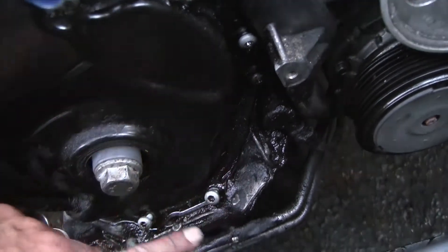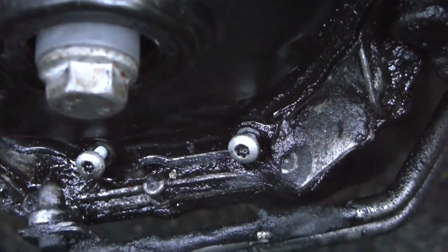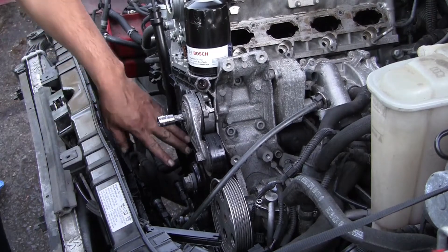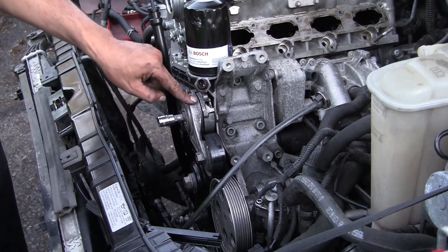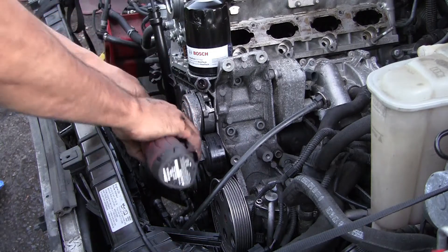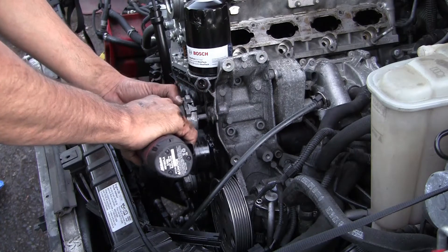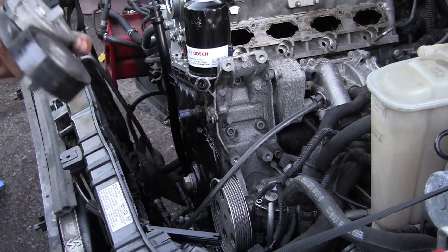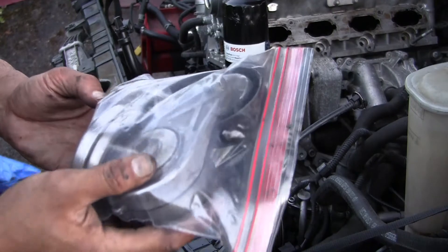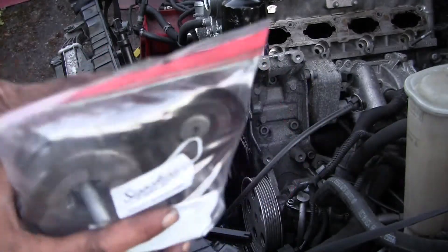There's a lot of junk, dust, and dirt that has piled up here, so I'm going to have to clean it first before I remove this cover. I'm going to remove the tensioner — it takes an M12. Once you remove the tensioner you have a nice clear area to work in. As I always recommend, I keep the pulley, the tensioner, and the bolts in one bag — keep them separate for each step.